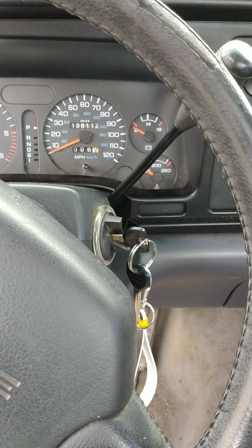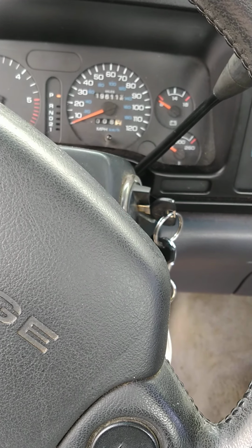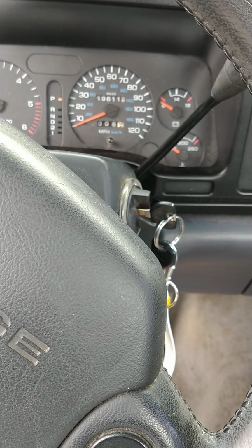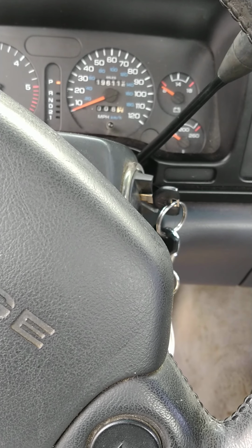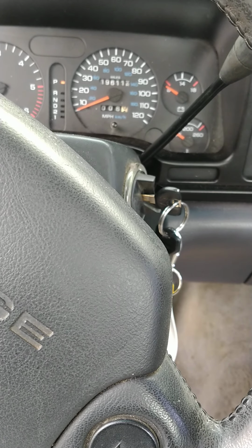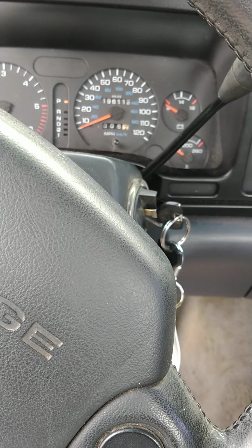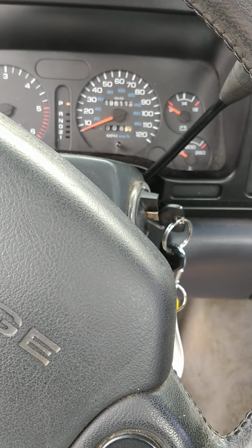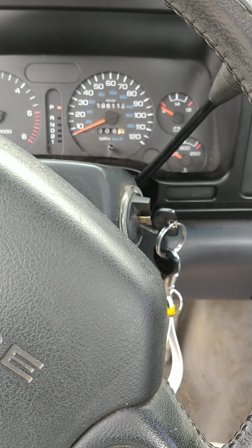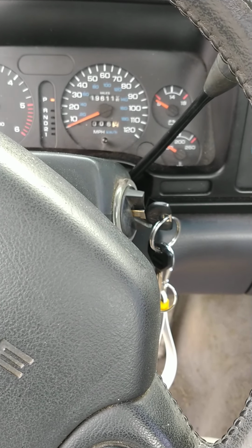But anyway, I had a guy tell me that more than likely they throw the cluster in it out of a six cylinder. I guess it's possible. These ECMs pretty much control these trucks. So, A, if you got a speedometer that's reading 70 miles an hour at 60, obviously it's going to shift out in overdrive too fast because the ECM thinks it's going 60 when it's not. And that's the only thing this truck does that's weird, is every now and then it'll shift out to overdrive at 40, 30, half 20. I'm lying. Anyway, I'll try to do better next time. But it just shifts out in overdrive too fast sometimes. Not all times, but yeah, about all the time.